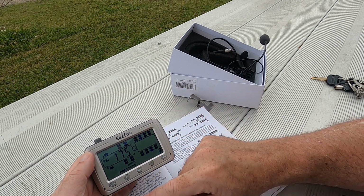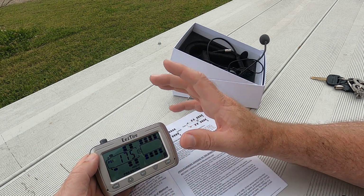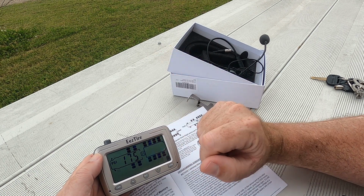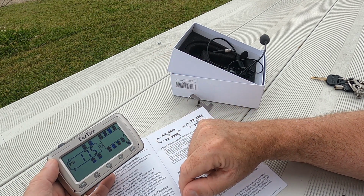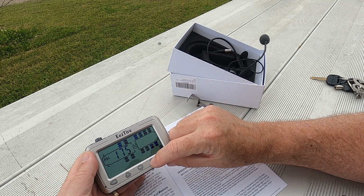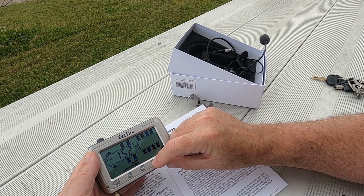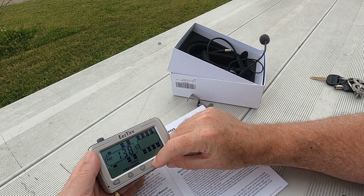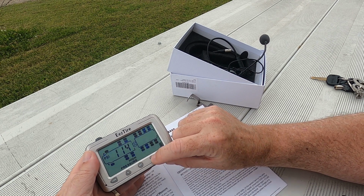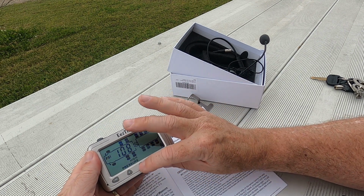So now, high pressure monitor for the front 2 tires. We said before we're running 90 pounds, so plus 18 is a 108. So we're going to go ahead and hit this minus key down. We're going to roll down to 108, and hit set.